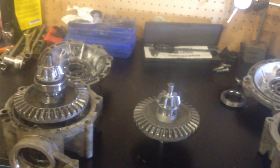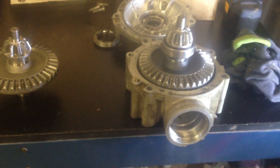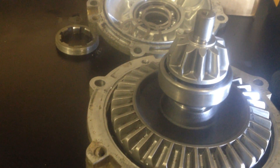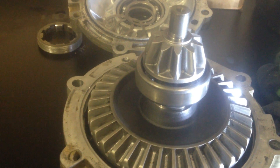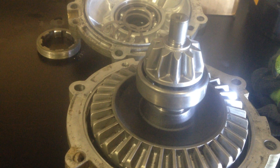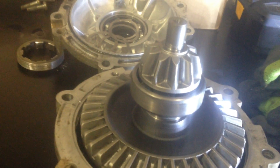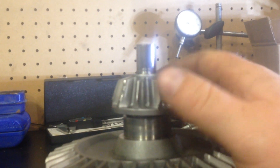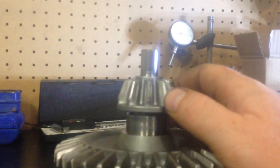What is it that causes these diffs to fail? Most of you guys probably don't give a shit — you just want to get on your bike and ride it, and you don't want your differential to blow up every two or three hundred miles and be changing it three times a season. For guys that do care, here's what happens: this pinion gear starts off life as a brand new, happy, shiny gear, and shortly into its service life it starts to wear. You can see that neat little wear pattern — wearing prematurely. Move on down the road a couple hundred miles, the wear has gone worse. Then some teeth break, some teeth pit, teeth chip, some teeth crack. That gear is starting to get pretty thin — that's why it's breaking up top.